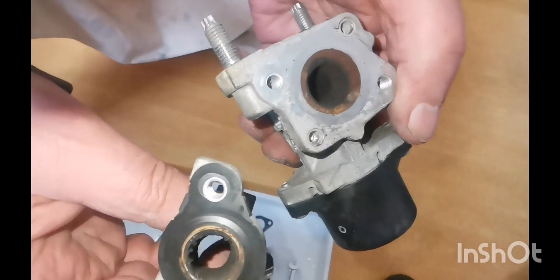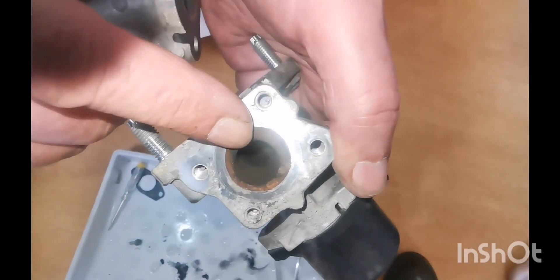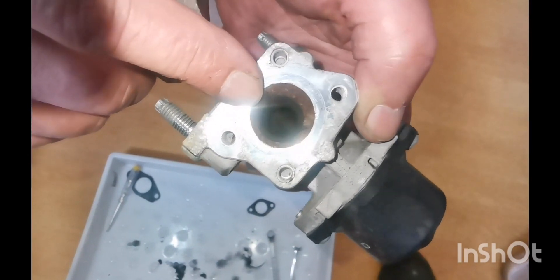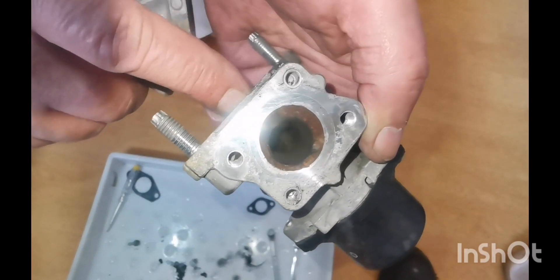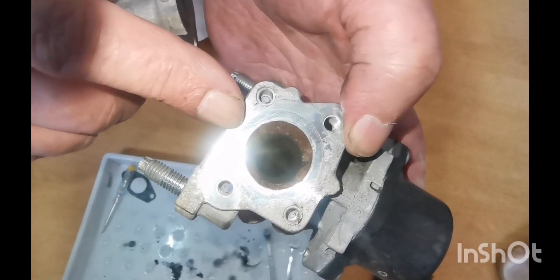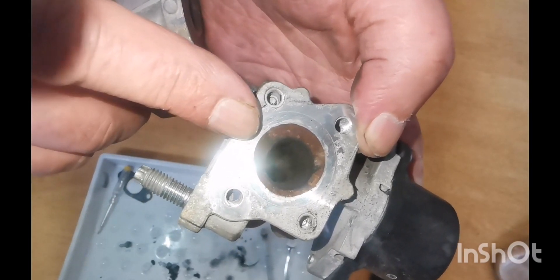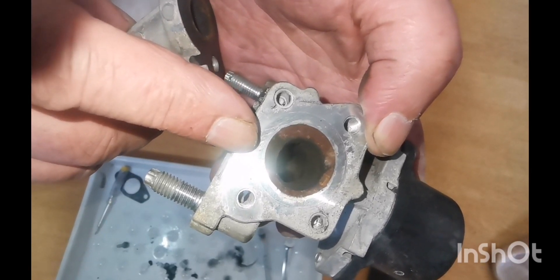I've just looked at this part of the EGR valve which I've taken off, and as you can see it's full of dirt in there. All of the soot inside is completely clogged. We will try to ease off this valve. Sometimes it was sticking and losing power because of that and also making a rattling noise. I hope that after cleaning and fitting it back this might solve the problem, and I will show you whether it has made any difference.